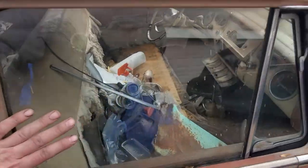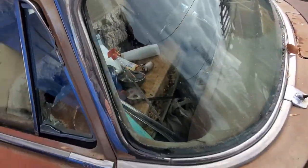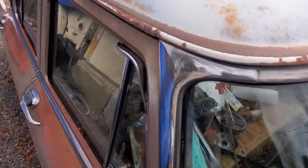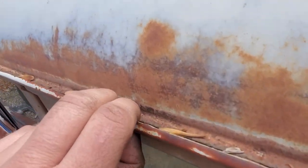I'm going to get this covered up as well. I went through and siliconed up all the holes in the windshield gasket, and you can see that worked pretty well. Got to fix this drip rail - I think these drip rails on here were just attached with that seam sealer, which seems a little weird to me.